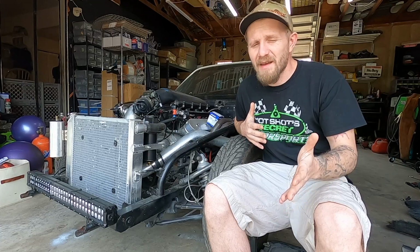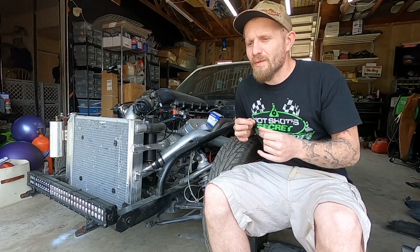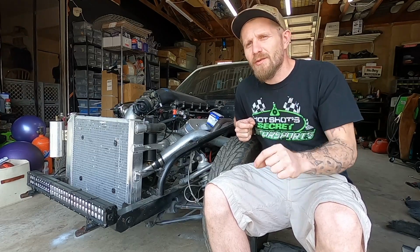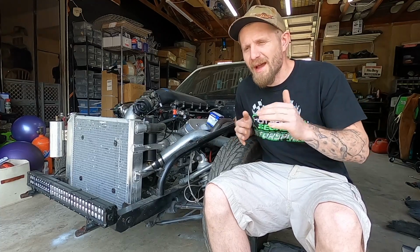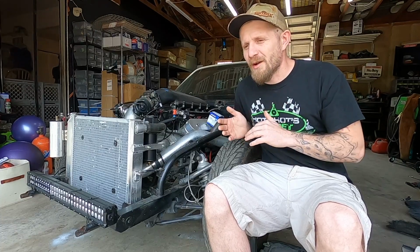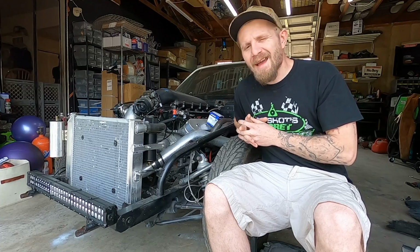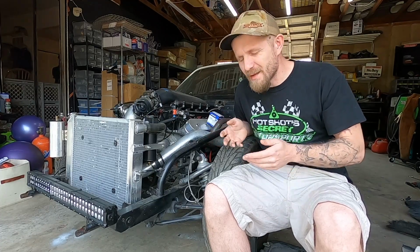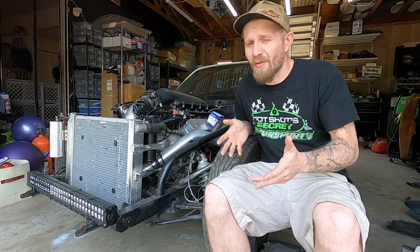We were hitting a safety cut for the oil pressure. Part of the issue there was we also had the oil pressure safety set a little too high on pressure and a little too low on RPM. We were being ultra safe on it should have this much pressure at this much RPM, that kind of stuff. And I didn't really see any issue otherwise. I pulled the dipstick. It's got a little ethanol in there. It's probably time for an oil change, but I don't think it's the end of the world.